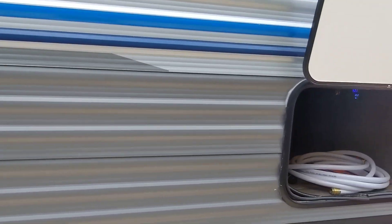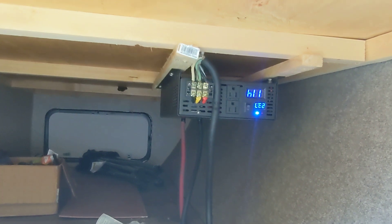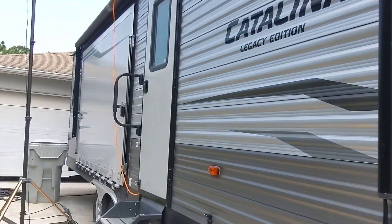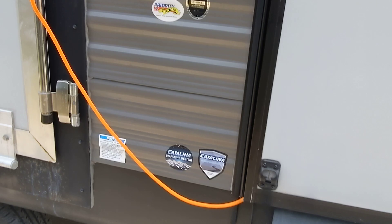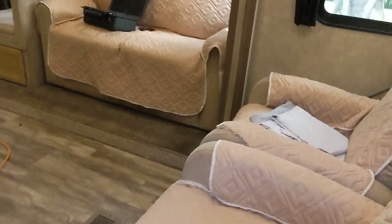This RV is running ice cold inside, completely off-grid solar. My Icom 705 is on battery — there's the inverter, we're at 23.7, that's off by 0.3, so we're at 24 volts on my 24-volt battery plant, completely solar with air conditioning inside. I've got my cables running in the door here.